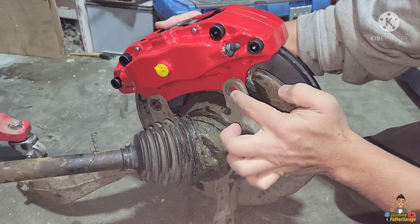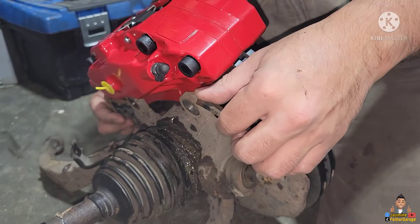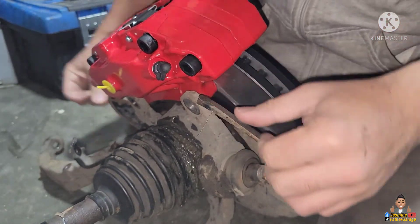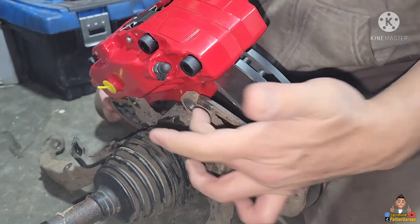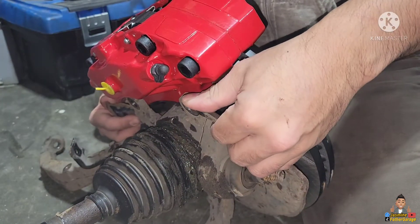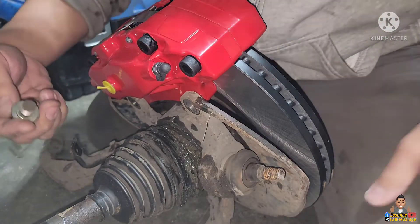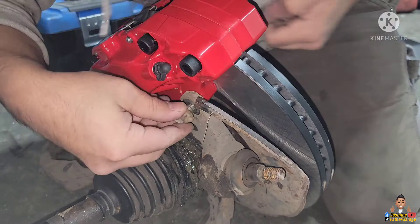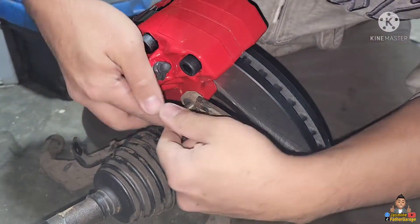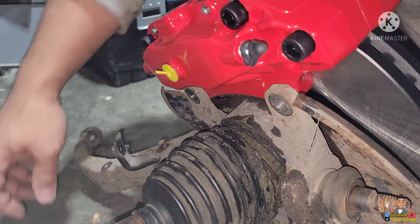You can see that the bolt hole is not lining up, so I kind of bent the shield outward a little bit so it won't hit the caliper. I'm gonna be cutting this off once I get all the fitment right. Bent it out and it looks like this might work, so doing a direct fit of this caliper to the knuckle.